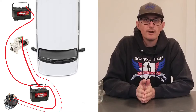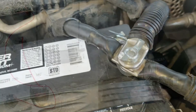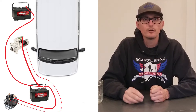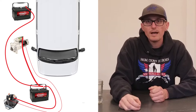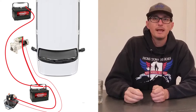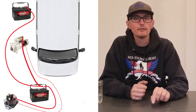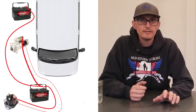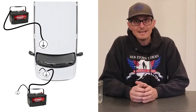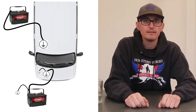So how are these batteries wired into the van? Let's look at the positive wiring first. The under-hood battery has three positive wires coming off the terminal. There's a 1-0 wire that goes to a starting relay mounted on the inside of the passenger side fender. There's a long 1-0 wire that goes to the frame-mount battery, and there's a 2-0 wire that goes to the starter. There's also a skinny little wire that runs from the relay to the starter — that's how the ignition switch ties in and energizes the starter. On the negative side, both batteries have a 1-0 cable that grounds the engine block, with 10-gauge chassis grounds that come off the ends of that.